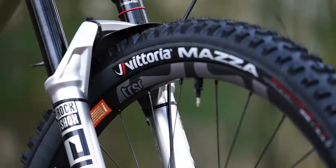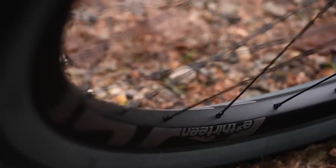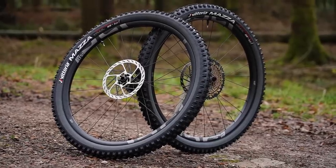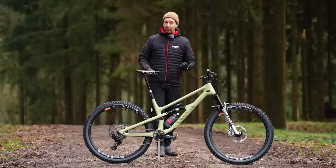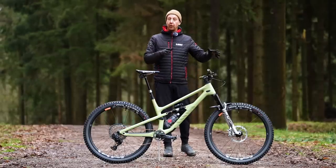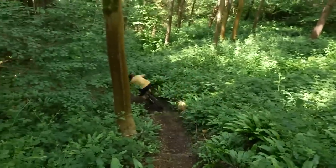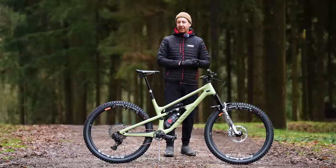The TRS wheels themselves are 27mm internal width — very slightly narrower than the XCX 28mm rim — but there's loads more material on these rims. They're stiffer, they're more durable, and they're going to take a thrashing by comparison. You've got 28 spokes front and rear with triple butted spokes as well, removing weight where you don't need it but making sure they still retain stiffness, strength, and a bit of compliance — super important with a wheel this stiff. If you're a heavyweight rider who likes to ride the lighter end of trail riding or the tougher end of cross country, you can still do it on these wheels. They are a couple of hundred grams heavier than the cross country race wheels, but a lot stronger and more durable — they could cross over into that down country category.